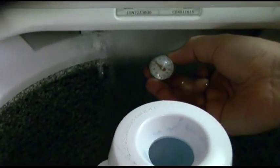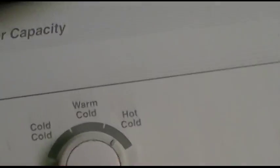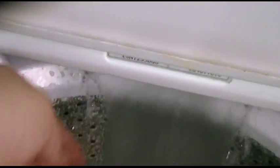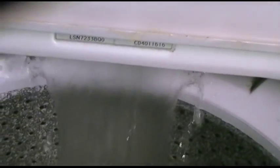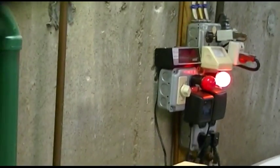Now there's more to the story — this switch overrides whatever the dial is set to. So if that's on, you're getting warm and that's the end of the story. Even if I wanted hot here and put it on for a wash cycle right now — the switch is off, it's taking hot. But if I kick this on we're going to get warm. Then we turn the hot enable timer — you'll hear the clunk of the electric valves, and now we have just hot water. When that timer expires it's going to fill with warm — so there's your hot/warm.